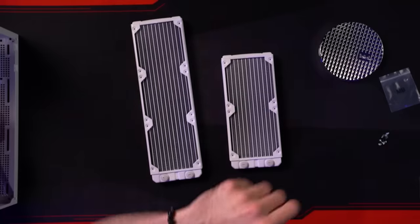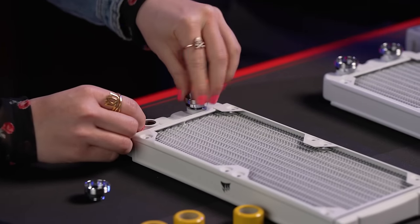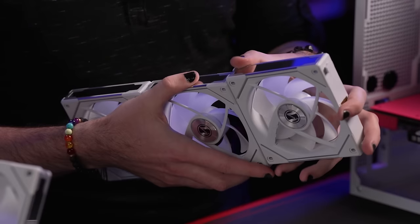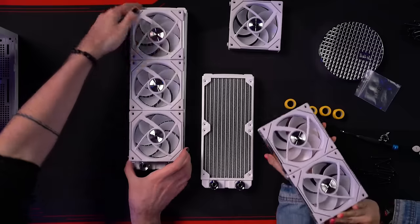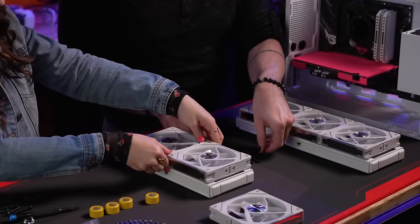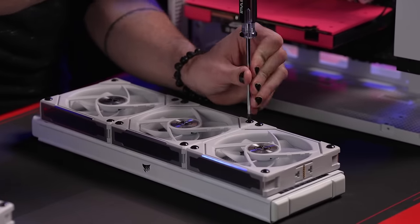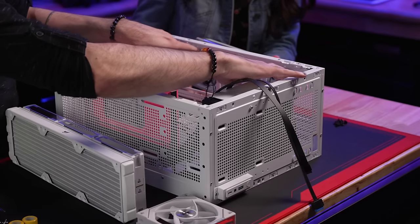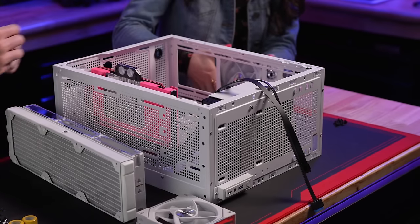Next, we install the two 16mm hardline water cooling pipe fittings onto each of our two Corsair radiators, snap together our extremely convenient and stylish Lian Li Infinity fans, then mount them all securely in the correct orientation on the radiators on the first try. Now that both radiator assemblies are assembled — and also rad — we mount them onto the case using the convenient radiator mounting rails.